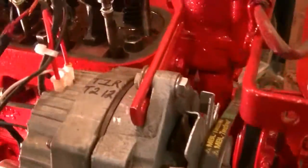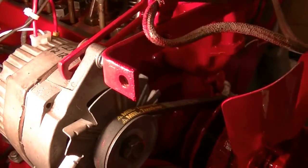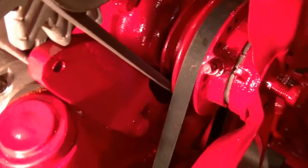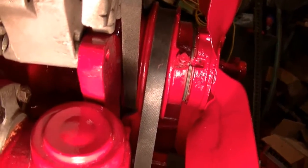The alternator top mount is from this application — it suited what I needed. The bottom mount is a heavy piece of steel, 5/8 by roughly 2 inches. The bolt heads come out of the front cover, making a solid mount. It only has the one bolt with no backup, but it's worked well in other applications without any problems.